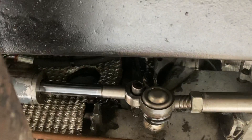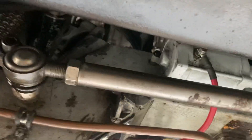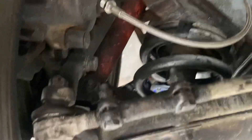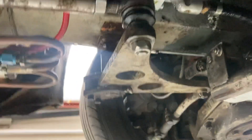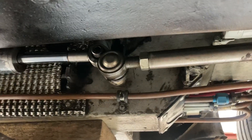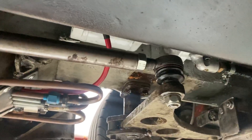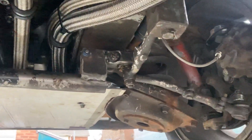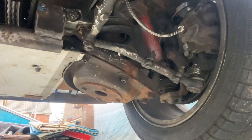You can't have anything much under the engine, so we've only got this rod to the steering and that's it. It's Jaguar Series 3 suspension with Aston Martin Zagato springs. There's a serious big bell crank, and there's an auxiliary ram because it's a BMW power steering box — but it's not quite right, I'm still not 100% with the power assist. It's still got a little bit of development to do on that, but it's driveable.